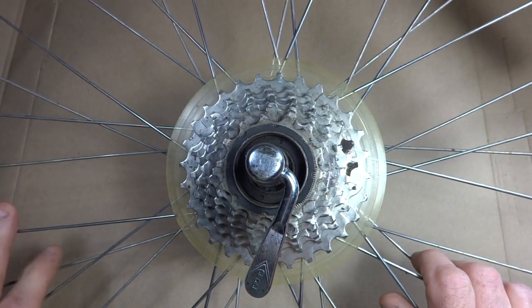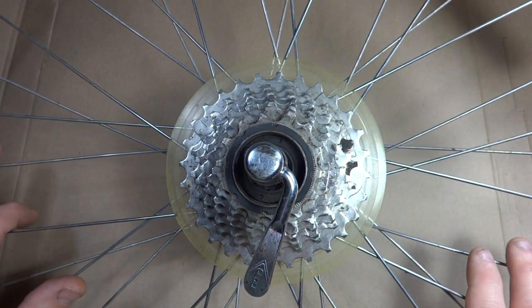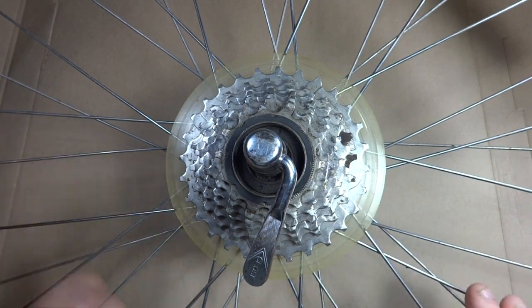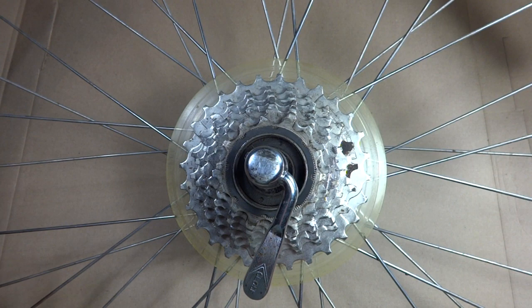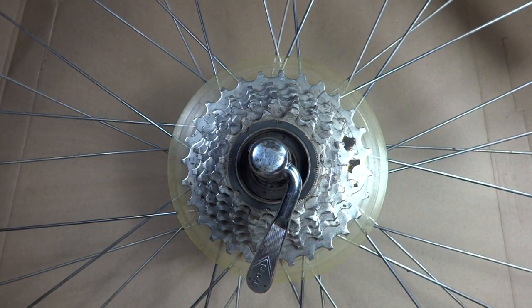I was working on this bike and the rear wheel wobbled, and I thought it was just out of true. So I pulled it off and put it back on to make sure it was straight, and it still wobbled but it wobbled differently. There was also a small catch in the hub, so I took it off and took a closer look, and I'll show you what I found.